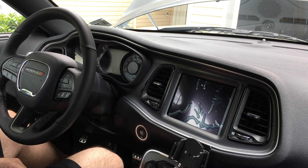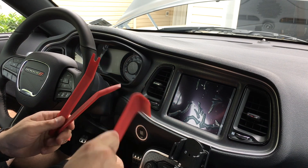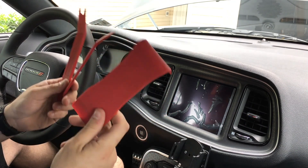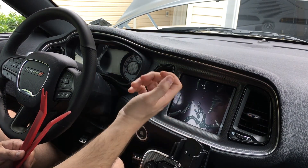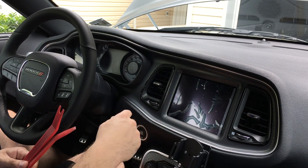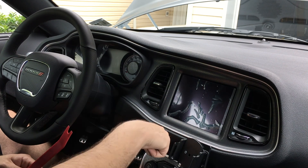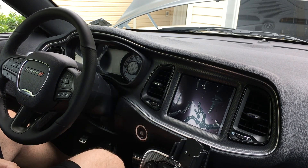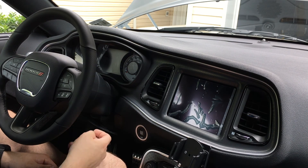Pretty much all you're going to need is some body panel removal tools — I don't know which one I'll end up using so I just grabbed all three. We're basically going to take this whole piece off here. It pops off, and there are some orange clips behind it which you have to make sure you don't lose, because some of them might get stuck and pop off on the bottom — that's what happened to him, so fingers crossed that doesn't happen.